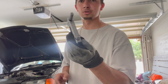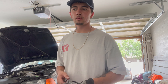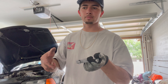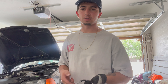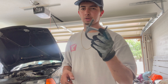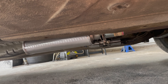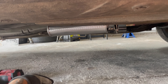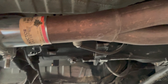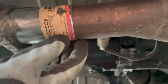So these are the dimensions. I don't really weld, so I'm using these exhaust clamps. The pipe from the exhaust manifold is two inches, and the Cherry Bomb is two inches, so I'll use a flow adapter that's two and one-eighths inches, about four inches long, to attach both ends. And I'm using these clamps — two and one-eighths — to clamp it down.